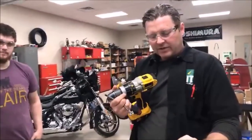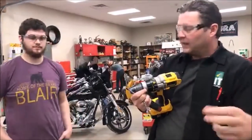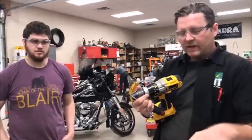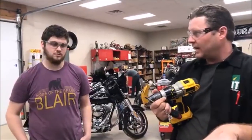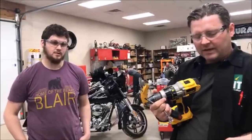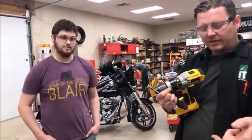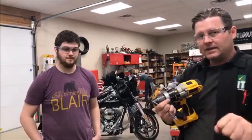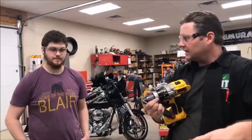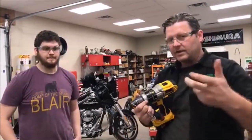The advantage there is that if I just pop the head off, that's going to allow me to get the cover off and take the rubber diaphragm out of here. I'm going to put a new master cylinder and rubber parts in here anyway, but what it's really going to allow me to do, by only popping the head off, is leave me a set of threads proud of the master cylinder, so I could get on there with vice grips, and then I could use heat. Do you get where I'm going with this? That would be a way that I could get it out of there.